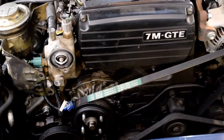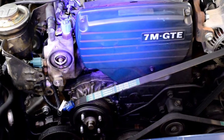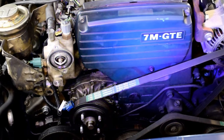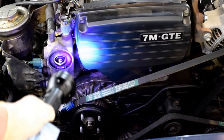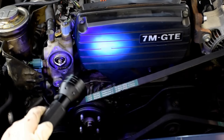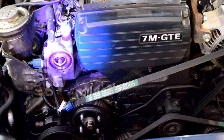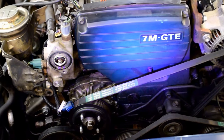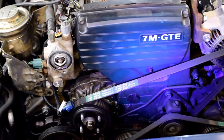This UV business is tricky with old plastics — the plastics themselves radiate quite a bit, so it's hard to tell what's coming from the plastic versus the oil. If you look at the timing cover, you can see it is glowing pretty good, but that is just the actual plastic, not the UV dye. So that is making this a little bit tricky. I'm going to take off that cover and look behind there to see the problem further down in that timing case.